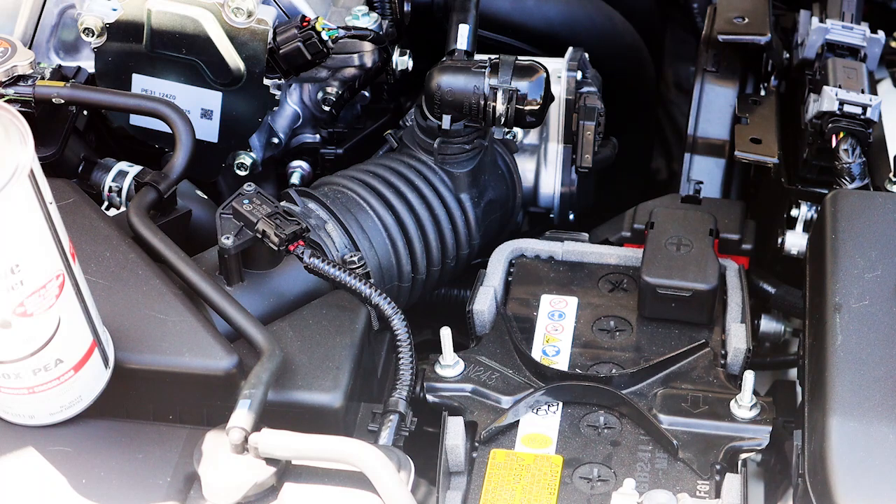As a result, fuel does not wash down on the valves and intake ports, and therefore carbon builds up in the intake manifold and on the backs of the valves, and you want to do this cleaning regularly. Normally I do it every time I do an oil change.